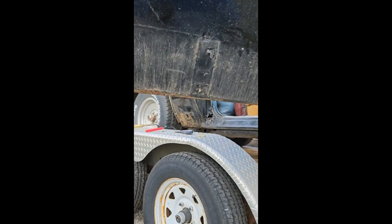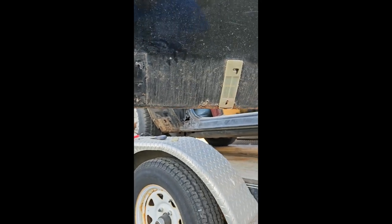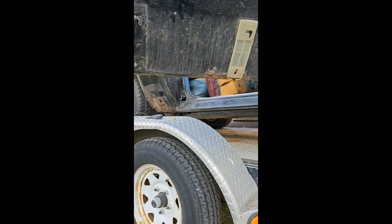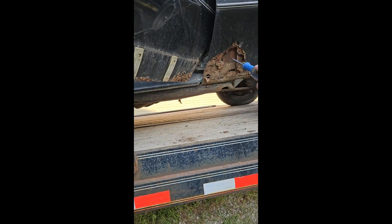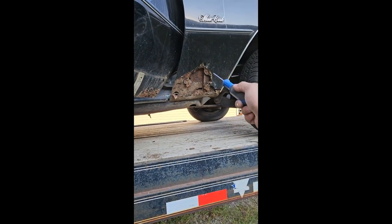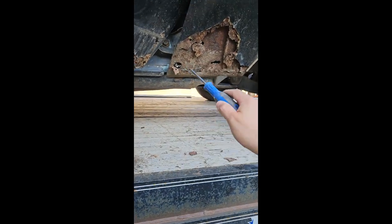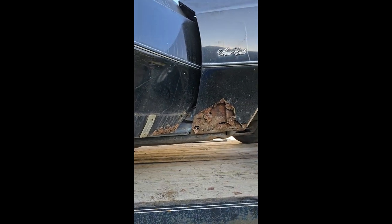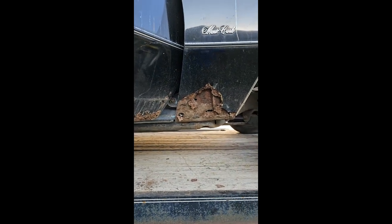Basically you have to fit your molding, draw a line, and put your studs on. Set them all out and get them close to the bottom, just like they are. Same thing on the quarter panel. Your door or your fender is going to be pretty much set in place, but you can see these holes are pretty big, so you have some space to move up and down — you can adjust it to fit your door. You pretty much have to fit your moldings before you do any paint work. That's really the only way to get them true and straight.